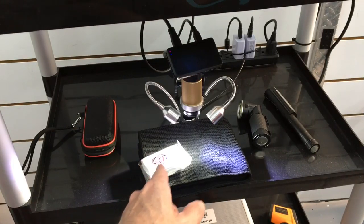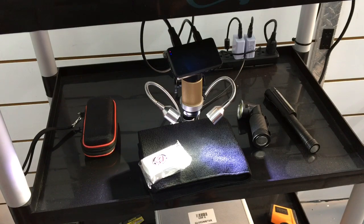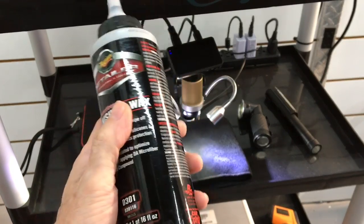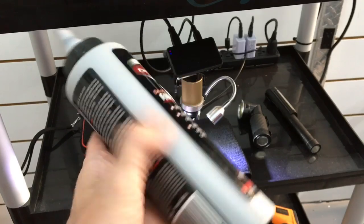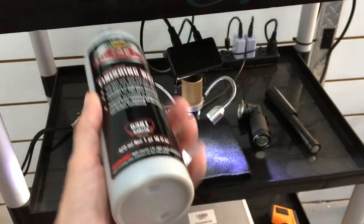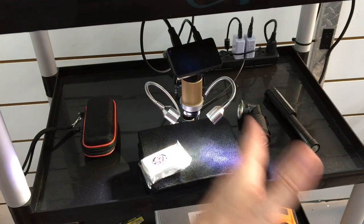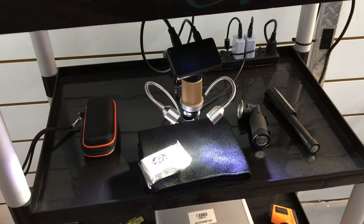First we'll take a look at the Adams Fine Grade Clay Bar. Natural, organic clay is abrasive by nature. For example, the Meguiar's D301 is just a finishing wax — not formulated or intended to have abrasives — but naturally it has abrasives because a clay was added to control moisture and clay is abrasive. I can use it to correct very fine imperfections because it does have unintended abrasives in it. Abrasives are also intentionally added in mild, medium, and coarse form, so they will mar your paint.